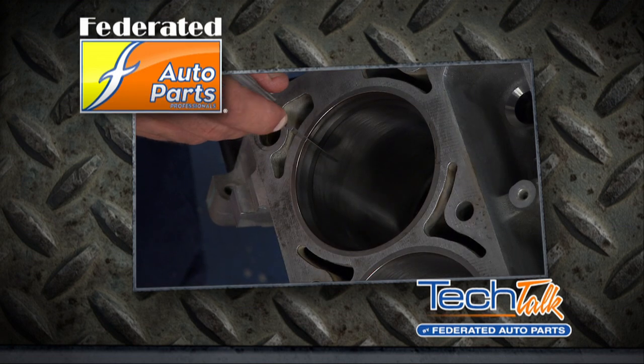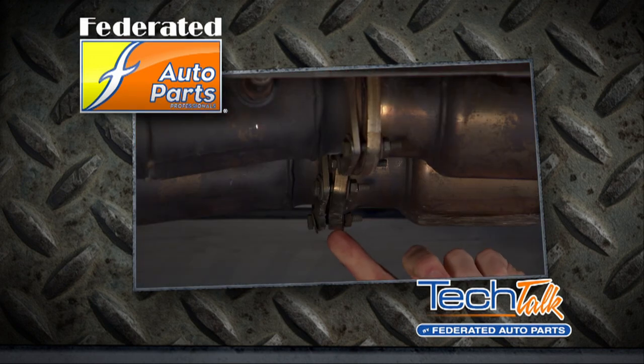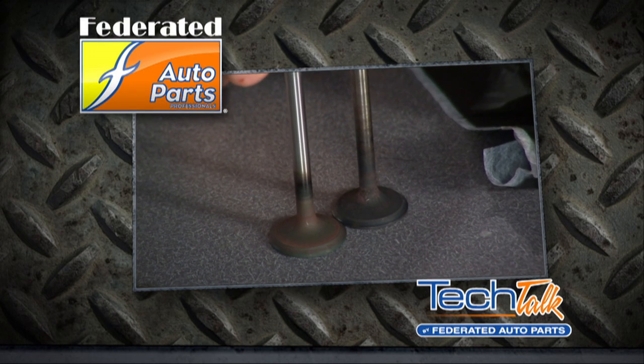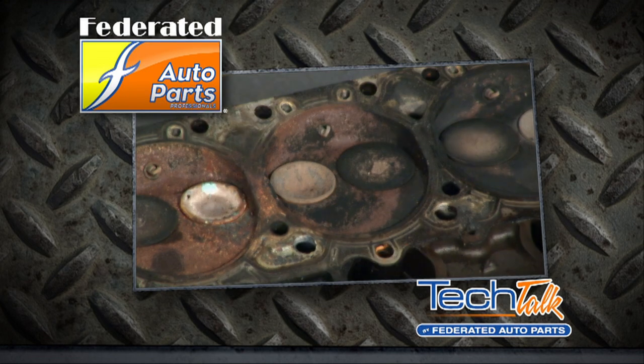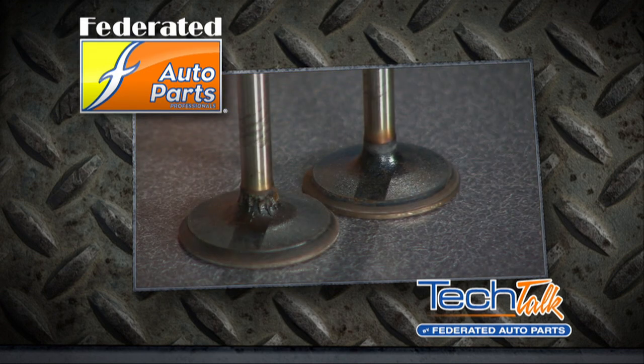A, broken piston rings. B, a bad head gasket. C, a bad exhaust gasket. Or D, an exhaust valve not seating. The correct answer is D. Look, you got it right. The exhaust valve isn't seating. We know this because if the exhaust valve were seated, it should be airtight.